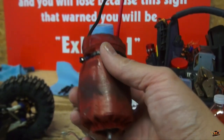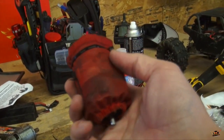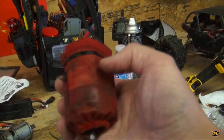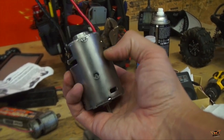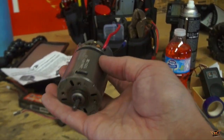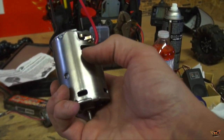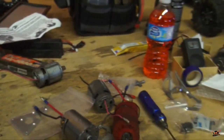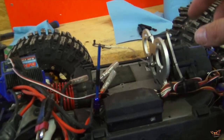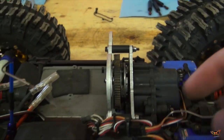But if you cut the toe off and zip tie it, that works too. You do not have to buy these filters. What these filters do is try to keep some of the heavier chunks of mud and rock out of your motor. The problem is these motors do create heat and they need to dissipate that heat. Kershaw does have - and you can get them from Integy or anywhere online - motor fins that fit right over and help get rid of some of the heat. I've got to get back to work to install them into the motor mount.